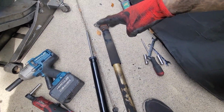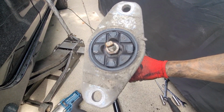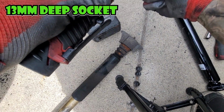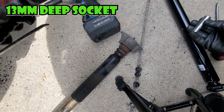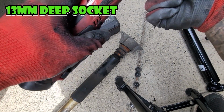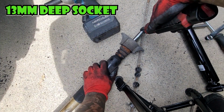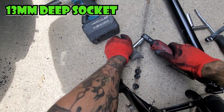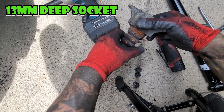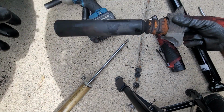So now we need to build it out. So we have to get a 13 on this top nut right here and break it free. It's not super tight. I'll put the torque specs in the description as usual, so don't get all crazy with me. I should be using a ratchet, but whatever. You can actually break it free easily, and then you can get this guy off, which unfortunately I need to reuse.